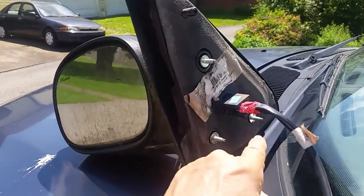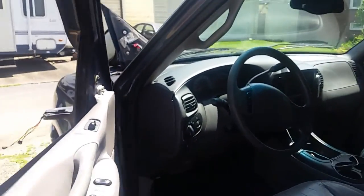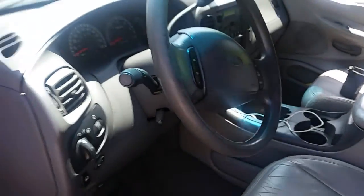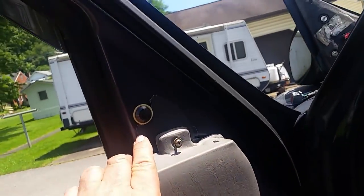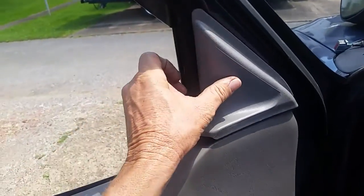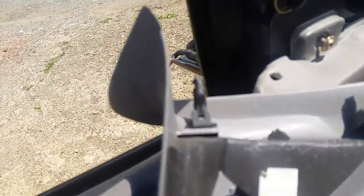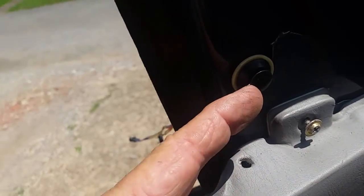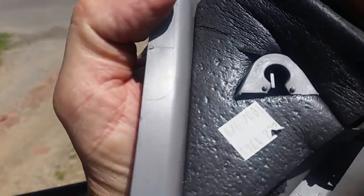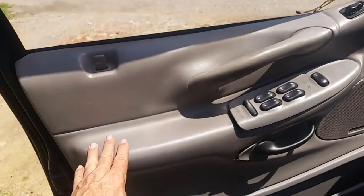But other than that, here are the three bolts — well actually these are studs, and you screw the little nuts on here. First thing's first, since this mirror's gone, we've got to go in here and start disassembling some things. The first thing we've got to do is pop off this guy here. Basically, it's on here like this — you've got to pull up like that, and as you pull up there is a little release tab there, a little clip-like feature that fits down these holes. There's a little plastic washer deal that goes in right about there, and that's all that holds that on. Once you pull up on it, we have to start taking this door panel off, which is not very involved. We'll go ahead and take this Phillips screw out right here.